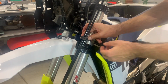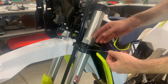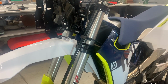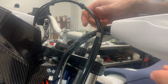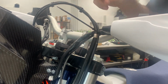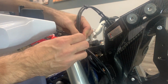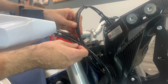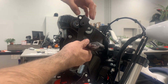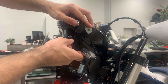It is easier to enter it on top where the brake hose is thinner. Make sure the RG is correctly oriented. Now you take the zip tie, take it through, and you secure it. Now you secure the brake hose to the cables from the handlebar, and do it only gently, don't tighten it, so there is still some flexibility. And on the side you put one zip tie also, and again you do it only softly, so there is still some flexibility. Take the turn signal holder, push it through the cable, and just catch it like this and leave it like this.